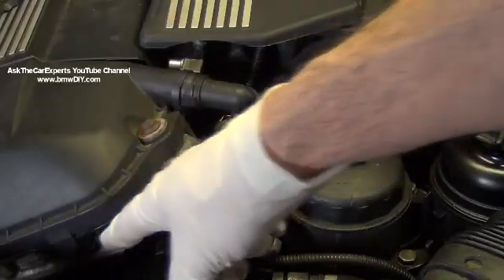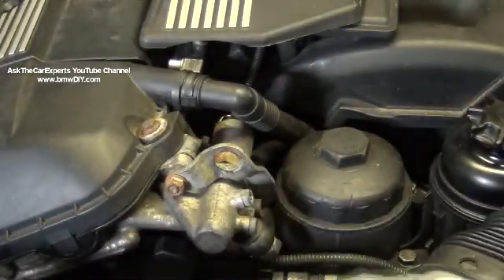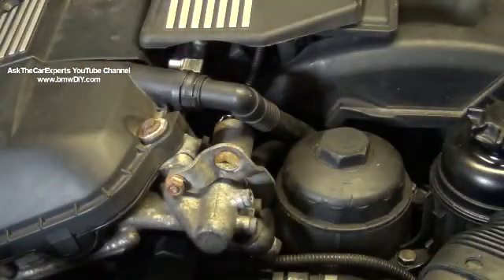There's one down the bottom — that one's actually been replaced. This one here has not been replaced. It was replaced because there are some timing issues on this engine. Eventually I'm going to be working my way to pulling the cylinder head off, but before I do that I'm going to do a video on setting the timing. I'm working my way towards the intake camshaft sensor, which is a common failure on these vehicles. So I just want to go over first removing the Vanos solenoid.